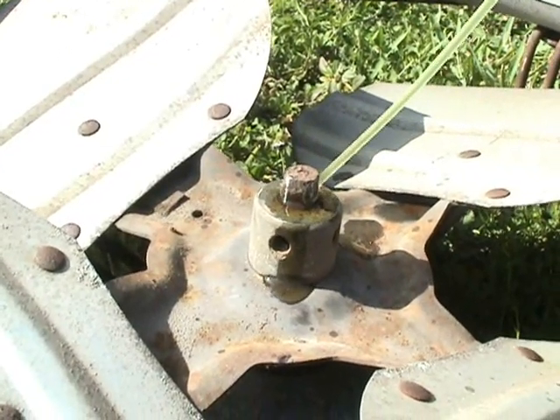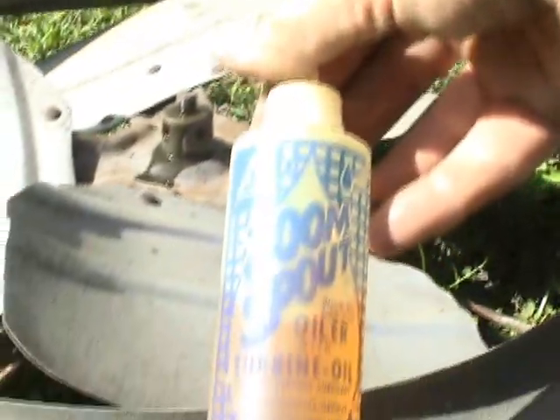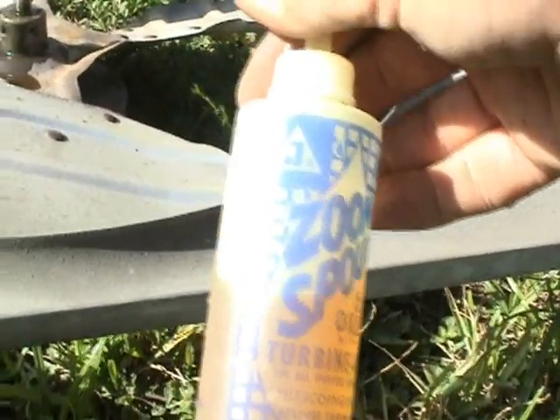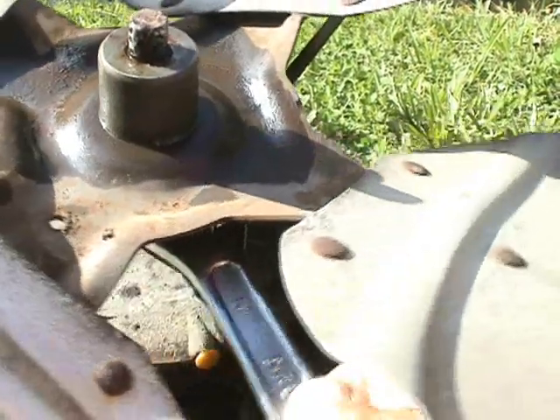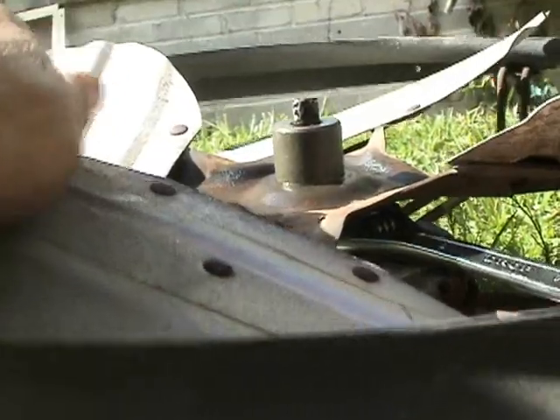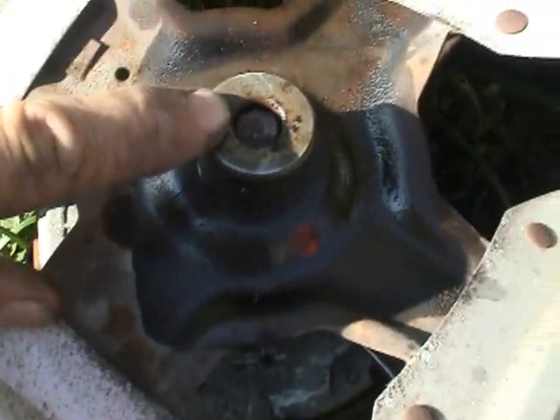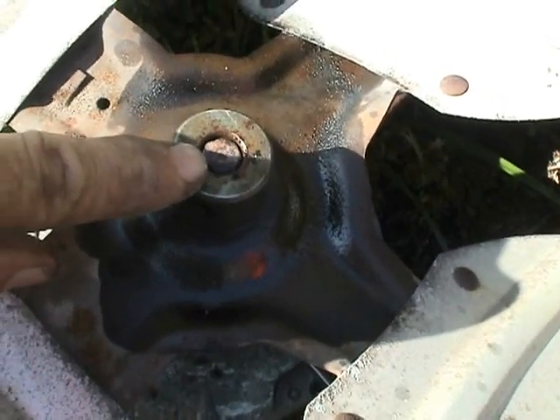I'll go with a little bit of oil as well, get some everywhere I can. This is Zoom oil - this is actually a great motor lubricator if you can catch the motor before it goes bad altogether. Now it's time to remove the fan blade. The best way I've found is to put a wrench between the motor and the hub of the fan blade and hold it in position. While holding the wrench in place I can turn the blade - this isn't going to be easy like it never is. See how it's already starting to work loose. Kind of have to work it a little bit. Sometimes pretty stubborn.